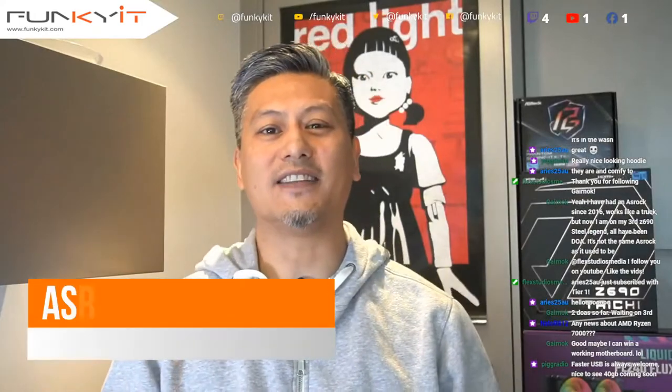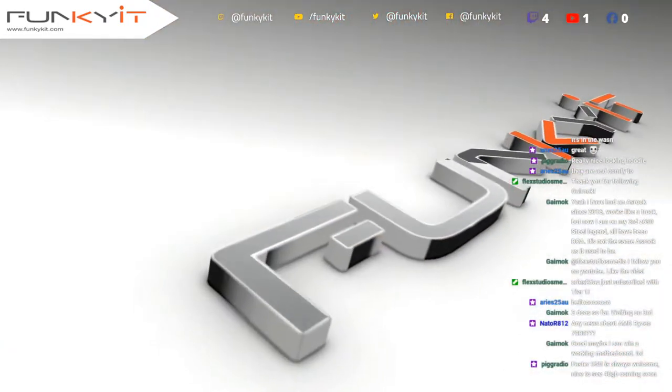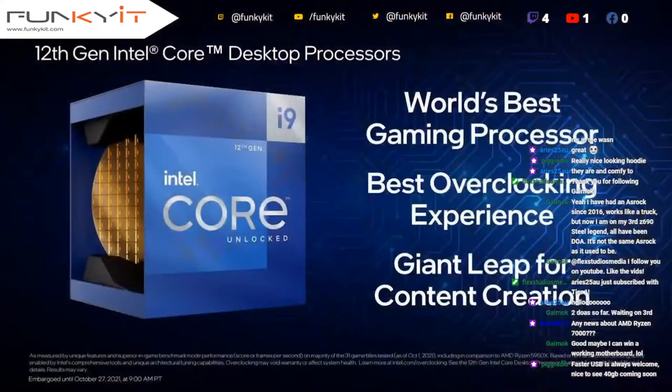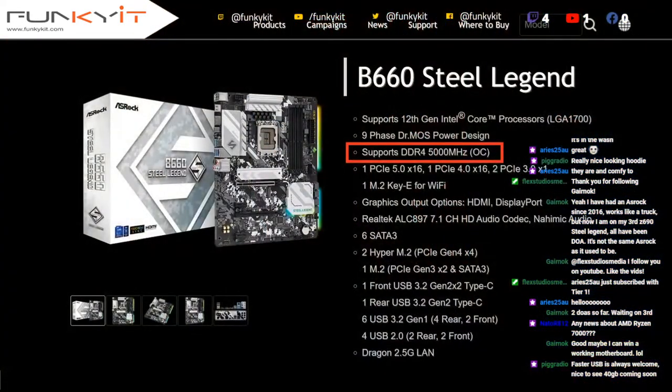Hey, what's up guys, Winston here, and today we'll be taking a quick look at the ASRock B660 Steel Legend motherboard. The ASRock B660 Steel Legend motherboard uses Intel's latest B660 chipset, supporting all of the latest Intel 12th gen processors. Now the main difference between the B660 versus the H670 is with the PCIe lanes. The B660 chipset only offers 6 PCIe 4 lanes and 8 PCIe 3 lanes, but it does offer support for DDR4 RAM with speeds of up to DDR4 5000 OC.